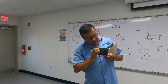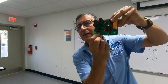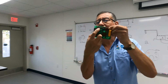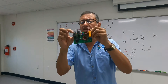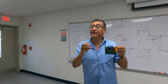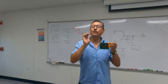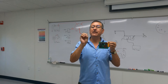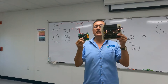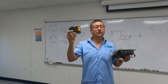When the engine is running, the LED on each relay should be solid. If the relay has a problem, the LED blinks — useful for diagnosis. This circuit board has the same function as the analog relay setup. For the digital board, if a relay is damaged, replace the entire circuit board. For the analog setup, you can remove and replace the individual relay directly.